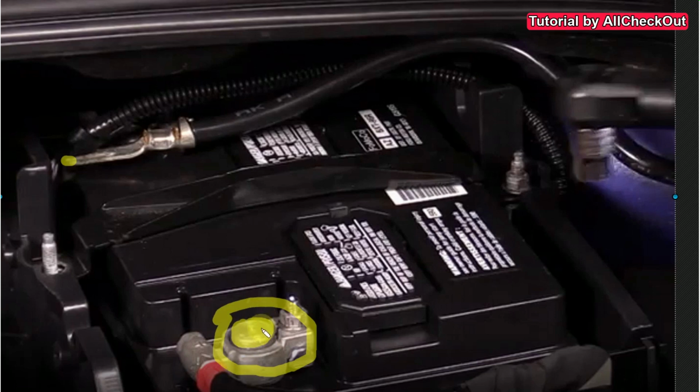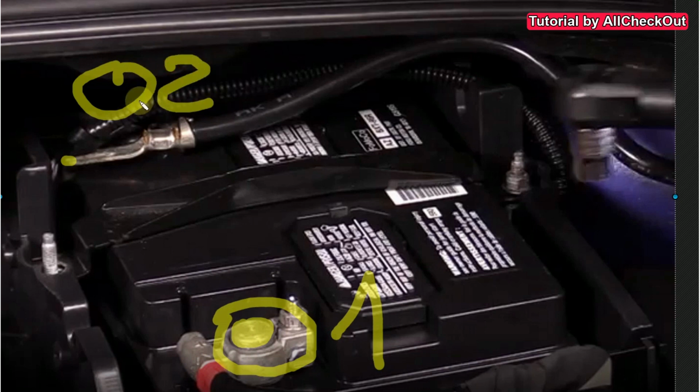Of course you have to do this here and also here in the back. And first, I think, as far as I know, we have to connect the red, means the plus, and then second thing the minus here in the back. Secure the screws and then jump into your car and try and see if it starts, and then only after that put this bracket and the screws here back. This is what I would recommend.